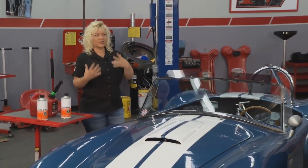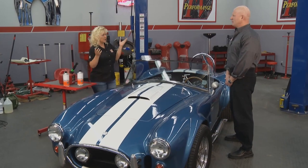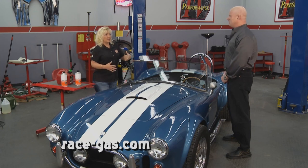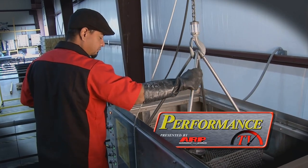This week's Fuel for Thought: how do you properly and legally store fuel at home - at your shop, or wherever - your race fuel? Dan is with us from Race Gas. People may not think about all the rules and regulations of keeping fuel at home. You don't want to find out the hard way - bring a 55-gallon drum of high-octane fuel into your garage, the house burns down, and your homeowner's insurance doesn't pay because you were illegally storing a large quantity of high-octane gasoline. In Minnesota, we're limited to 20 gallons stored at any given time, in 5- to 8-gallon cans, stored at a relatively constant temperature, away from heat sources and your furnace. A lot of common sense things on top of actual rules and regulations. Find out more at race-gas.com.